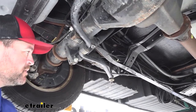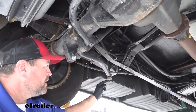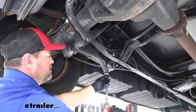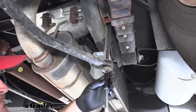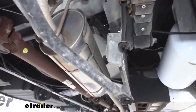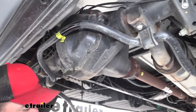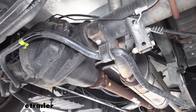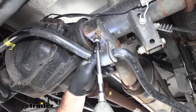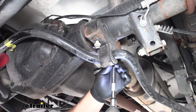To start our installation, we need to remove our old sway bar. We're going to start with our end links where our sway bar connects into them. We're going to take a 9/16 socket and remove the nut on the bottom — we'll have one on each side of the vehicle. We're going to take our sway bar and shift it down. We have two brackets, one on each side, and we need to remove both of those using a half-inch socket. Be careful here because the sway bar can be a little bit heavy. Loosen them so we can get them off with fingers, then use a second set of hands to help pull it off the rest of the way.